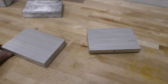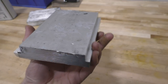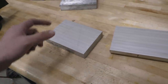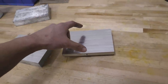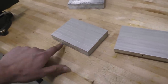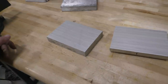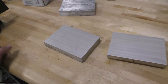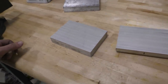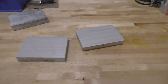So basically, we've made this part, which already fits into the vise perfectly, and we're going to add some super glue on this surface, and this surface is already faced, so we'll add some super glue on this one and super glue these two pieces together. Then I'm going to machine this part only from one side, and go all the way down till there's literally nothing left on this part. And then that will basically be my part. So I'll be able to make the whole housing in just one machining operation using this trick, well, one machining and one facing operation. It's still going to be much quicker than the regular ways of fixturing the part. So let's give it a try and see how it goes.